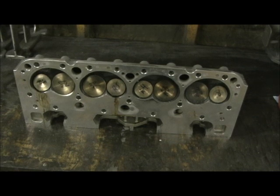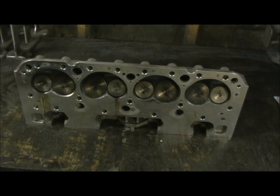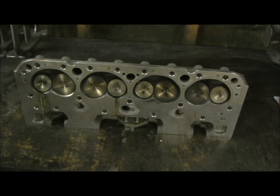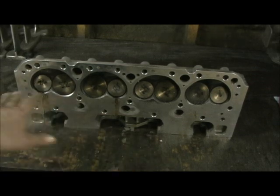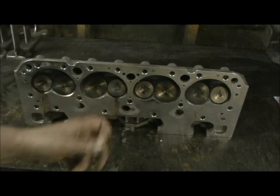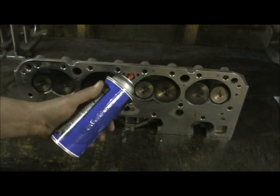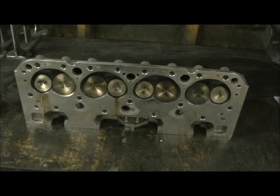I am going to do a follow-up on it. This is a stage three. I'm going to show you how bad the valve guides are and the valve job — the disassembly, the inspection, putting the new ones in. And the valve job when you're doing the three or four angle cut, that shows it right there. They also have a vacuum tester tool that you can use to pull on it that shows how much vacuum at the intake port. But this is really a simple test, because if it won't even hold carburetor cleaner with it standing straight up, you know that you've got a bucket of problems here.